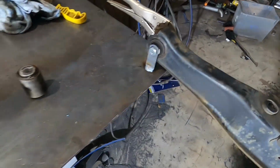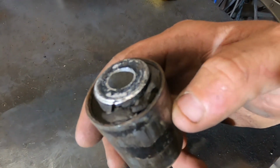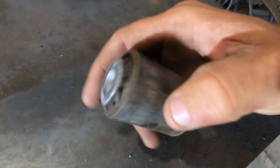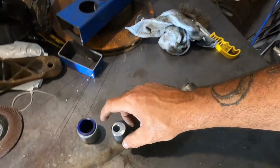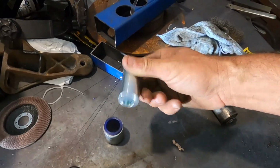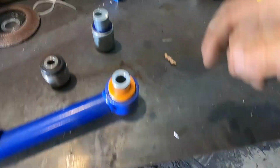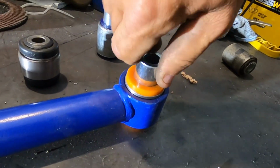That's going to be harder than it looks. But yeah, if you don't, you're going to end up having this sort of issue, where it splits the inner off the rubber bush and damages it. And that's normally when you've got to replace the bushes. The aftermarket ones, the crush tube pin normally floats separate to the bush. So it's like an offset Super Pro one. That's the ones that come in the camber arm standard, but see how they turn?